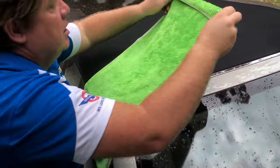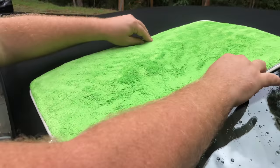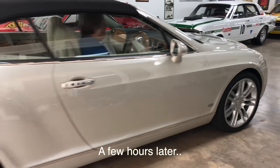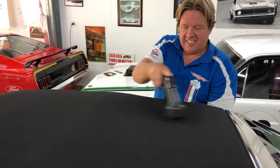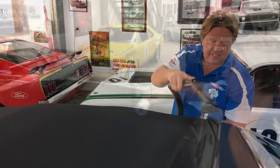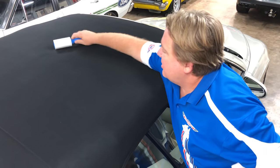Use the patting and turning technique until the whole roof is done and then leave it for an hour or two to completely dry. Move the car indoors and then vacuum the roof down with a soft brush attachment, removing any final dust or residue. Then run over it with a household lint roller, which you can get from any supermarket store. This will pick up any remaining errant fibers, lint or hairs from the brushes.